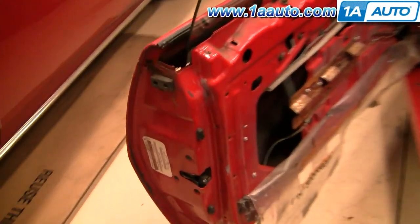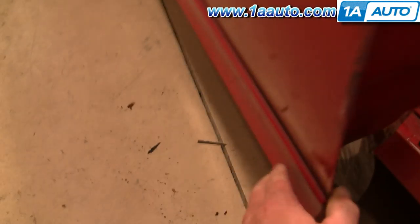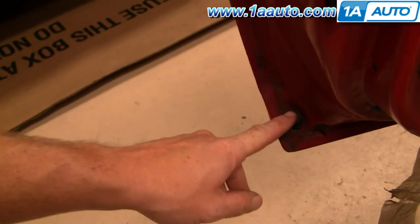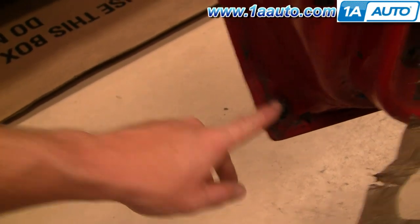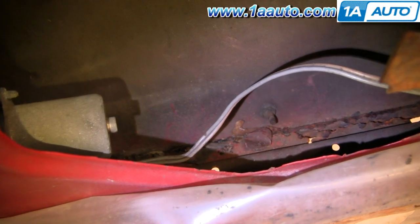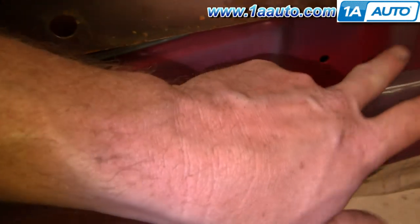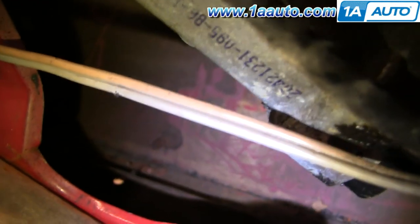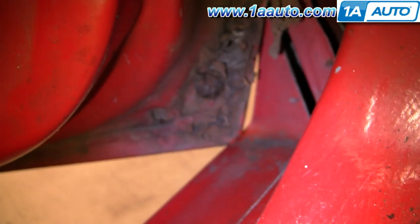To remove this piece of trim from the bottom of the door, you're going to need to have your door panel off and then your window at least partially up. You can see there's a nice easy one here — that nut comes off. Then inside the door, there's a nut right there, one right about in the middle of the door which you can pretty easily reach just by reaching in with your hand, and then there's another one right there and another one right up here.